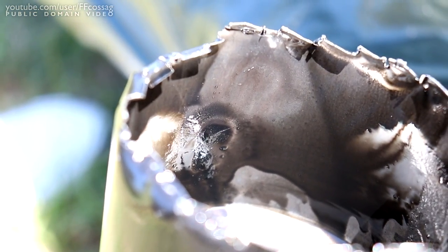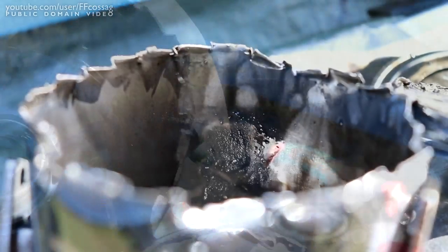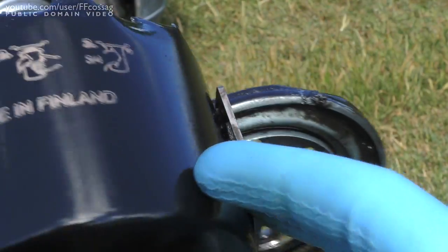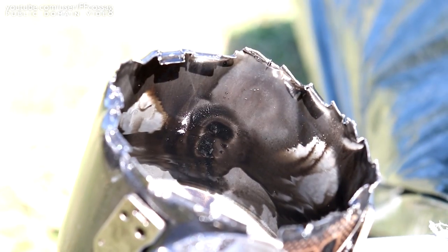There are definitely signs of metal sticking to the magnets. We've got a magnet — note the position over the lid there. We've got a magnet there, one there, one right there. There's one on the lid and one on the bottom. That's not going to show us anything since there's a bit of oil still sloshing around. But if we've got a magnet right there, if you look at the side, you can see that there's a bit of metal there.